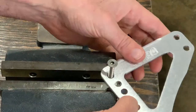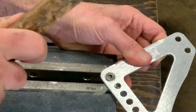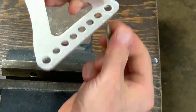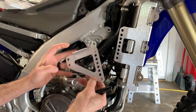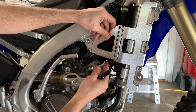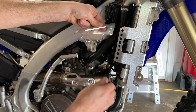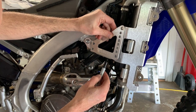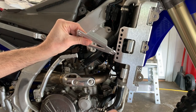That pops it clean. We're going to need to do this to both top and bottom. There you have it — that's how you get those out. Now that we have the grommets popped off, we have to do one other thing. Because of the fan there's a stiffener rib right here that is hitting the fan, so we've got to mark where this fan hits this guard and then trim it back — probably about a half an inch.